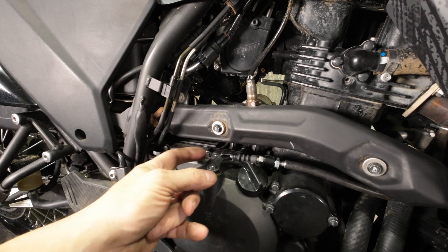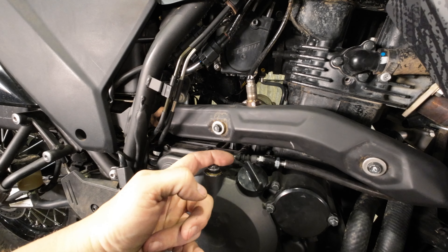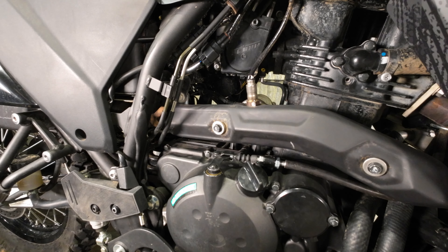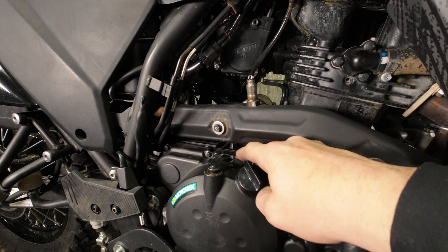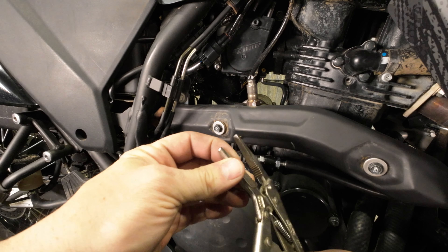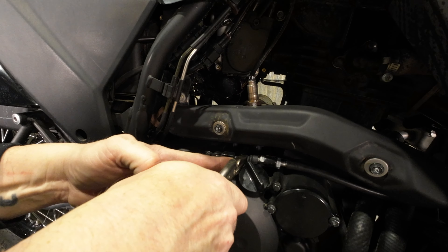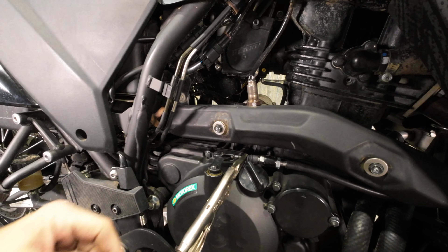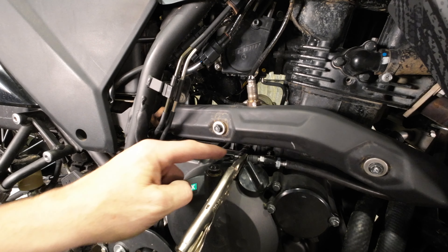With the stock arm there's a bit of a bump out, so we can't get the cable out of the clevis end until we rotate this ahead. There's also a little rubber boot on the newer ones that we want to make sure is out of the way. If you have some needle nose vice grips — preferably ones without a serrated edge — you can slide them onto the cable, and that's going to keep it from sliding back into the sheath when we rotate this ahead.